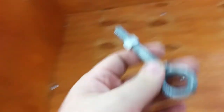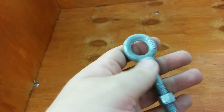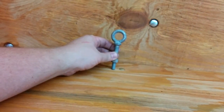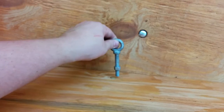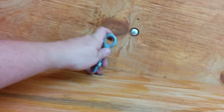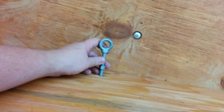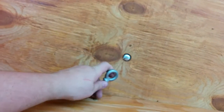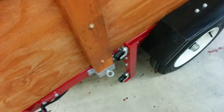When I thought about it later I realized I have a couple extra of these. I only have seven extra, but you'd need an extra eight. For the bottom bolt in these sides, you could use one of these guys — it gives you an extra tie-down strap right inside the trailer. You could make it swappable with a regular bolt so you'd have a smooth side for hauling loose material like mulch, but if you're hauling some kind of large object in the middle you could put a bunch of these in and still keep the sides while having appropriate tie-downs inside. I think I'm not going to do that, since I can slip a ratchet strap through the gap at the bottom and hook it into the side rail.